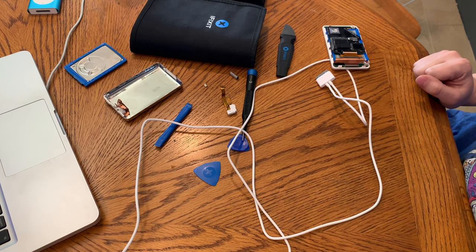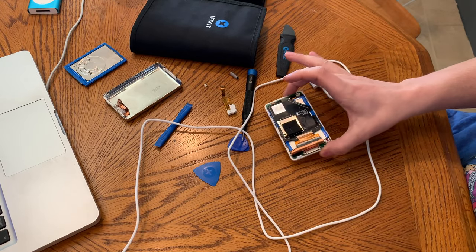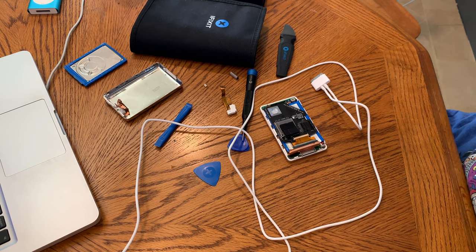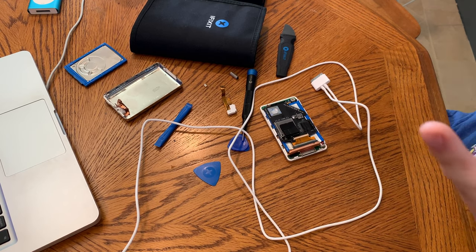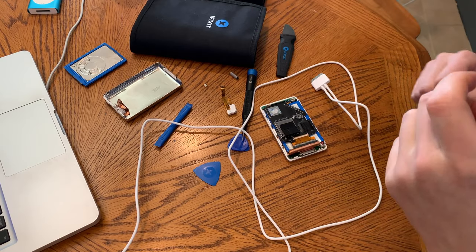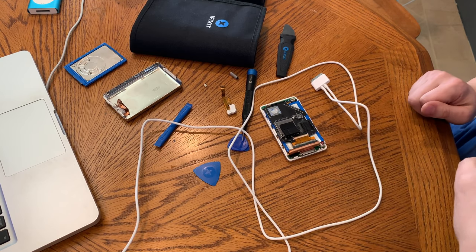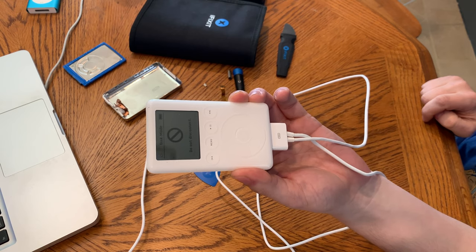It screwed up so badly I had to remove it from the adapter and plug it directly into the SD card slot, where it still would not read because it could not identify how big the drive was. So I had to download SD Card Formatter from the SD Association — the people that actually came up with the format. I downloaded SD Card Formatter, wiped it, and it reconstructed the whole drive. Now we can plug it back into the iPod and try to restore it again. It is restoring and it's getting further this time.